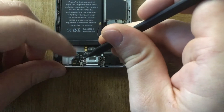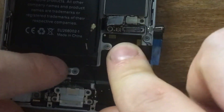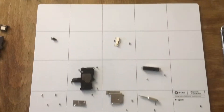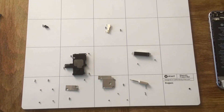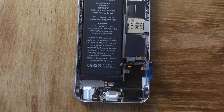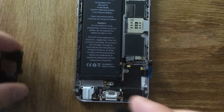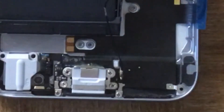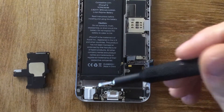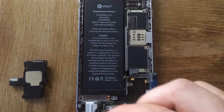This wasn't fitting properly at first, but then I noticed there was a little fold here. I don't actually remember how everything fit inside. Here's a look at the magnetic project mat — this is all the stuff I have to put back in. It looks like everything's in place here. To avoid making any big mistakes, I'm just going to use the iFixit guide as a reference. The antenna clip — it's this part, because it's missing from here. So these are in the wrong place — good to know. Apparently there was a screw right here that I also didn't do anything about. I figured it out — the microphone brace. I'm glad iFixit has very good photos.